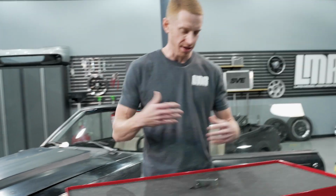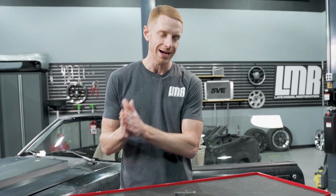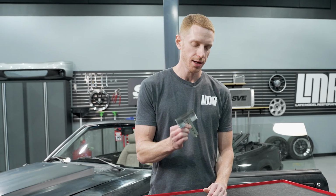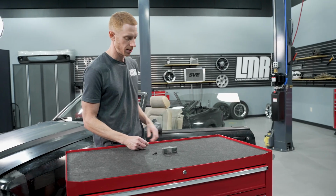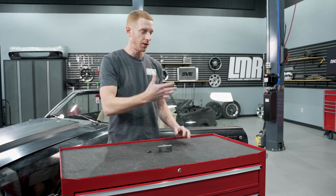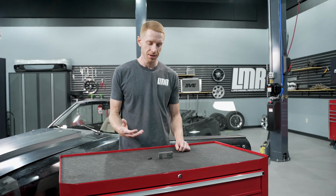Of course, some information kind of floating out there on the internet, I've never personally validated this. Early 1992 cars also had the fuel pump relay underneath the driver's seat. The easiest way to check if you have a 1992 car, glance inside your door, look at the door tag if it's still there, see what the production date was.